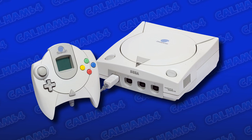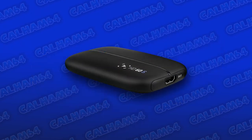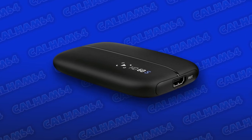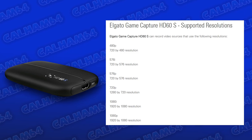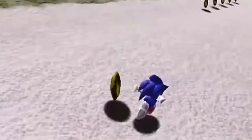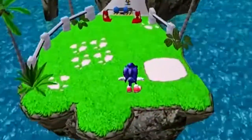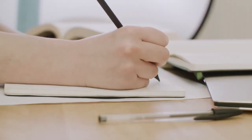However, the problem I had wasn't necessarily playing with Dreamcast VGA — that was all fine — but it was more trying to capture footage of it, particularly for capture devices like Elgato. Some capture devices only allow certain video signals, and the Dreamcast's 640x480 sadly isn't an easy one. If you want to capture Dreamcast in VGA quality, you need to find a capture card that supports it, or find a way to upscale the resolution. With me really wanting to capture VGA footage back in 2016, I did a lot of tampering and did actually find a solution. It was a very bizarre method — an absolute spiderweb of tech for just one console. Here's how this experiment went.